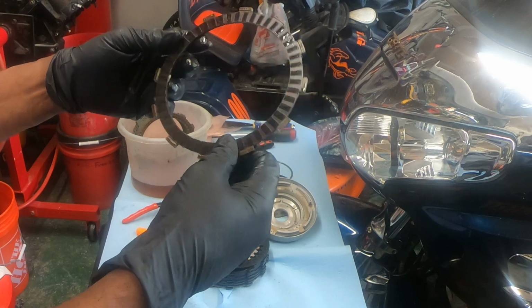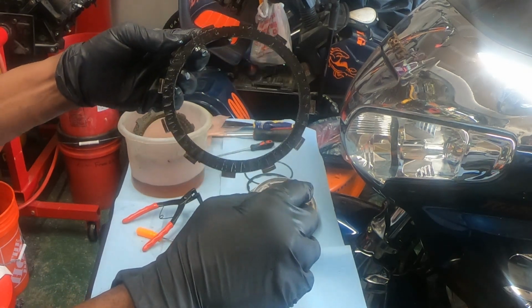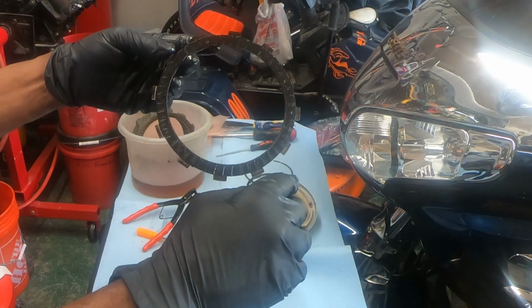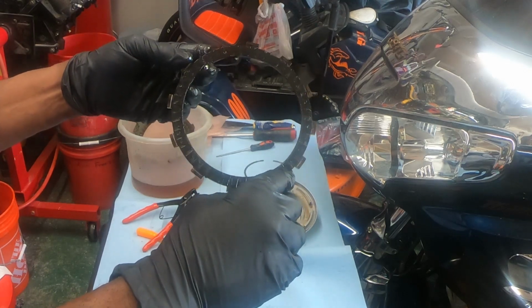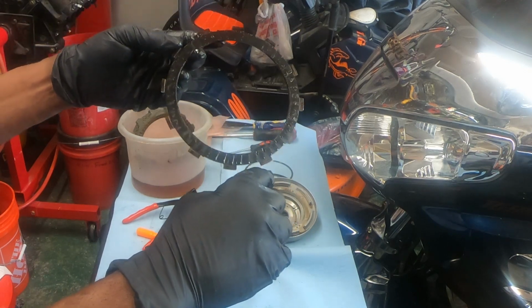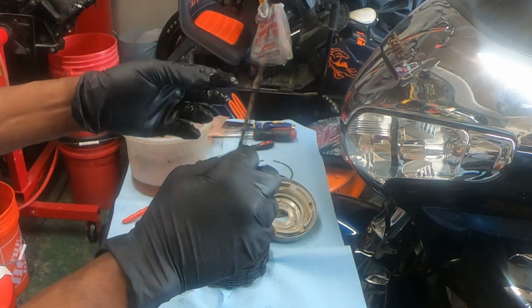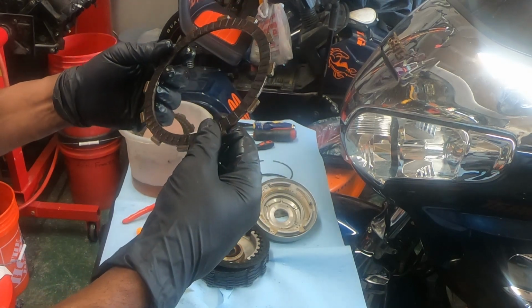I didn't have no gears at first and second. Then I came back and I bled my clutch. I got first and second. Then I lost fourth and fifth. Came back and I bled the clutch again. And I was going backwards. I would start off fine, and then halfway into like 5 minutes into the ride, I would lose a gear, and I just got tired of playing with it.